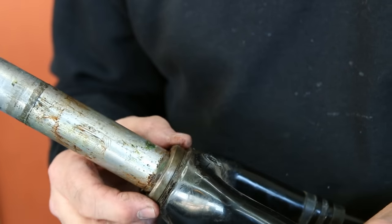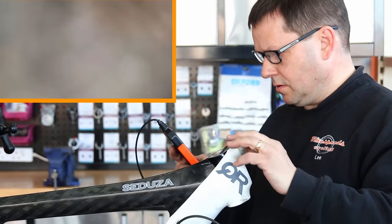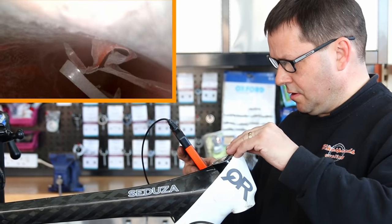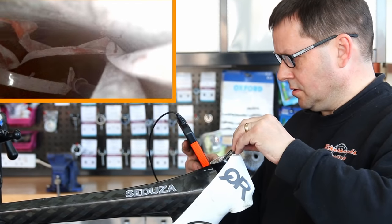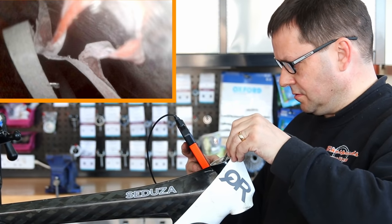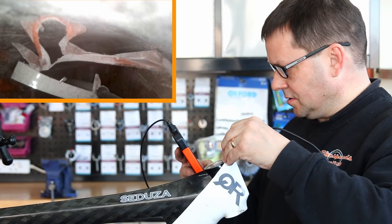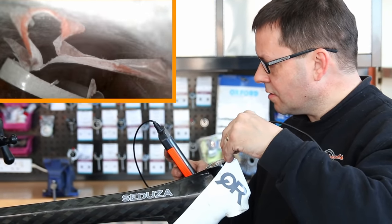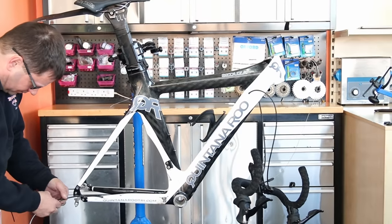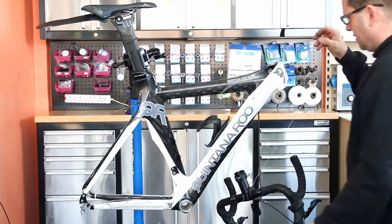As we were taking the bike apart, the headset bearings were absolutely gone. We tucked an endoscope down the frame to see what was going on at the bottom bracket and check for corrosion. Feeding it all the way down to the bottom bracket area, I could see on the bottom right of the screen a plastic tube with another tube inside it — that's a carbon outer for the cable, sitting in a plastic tube.